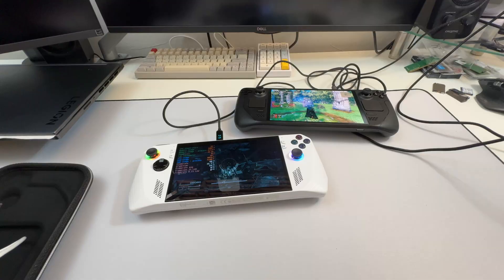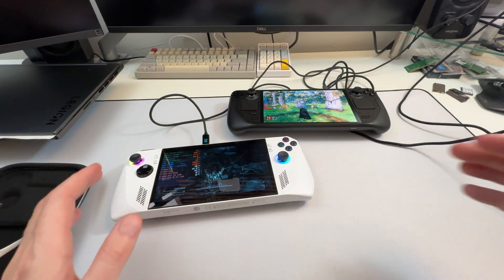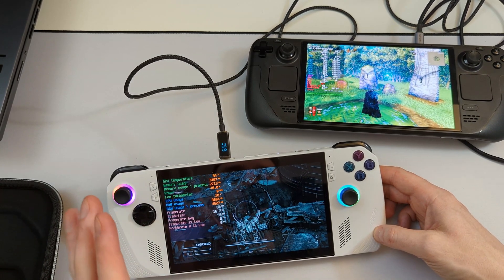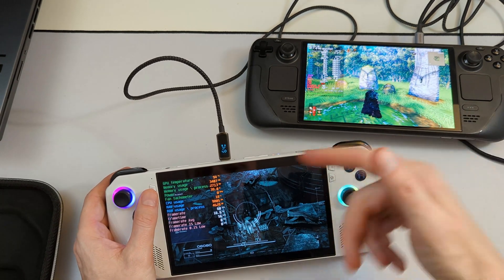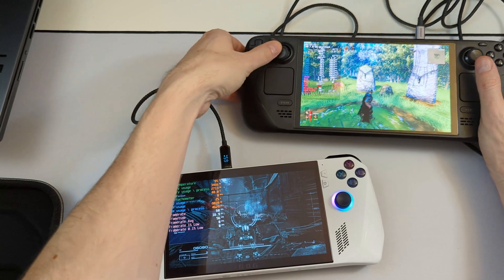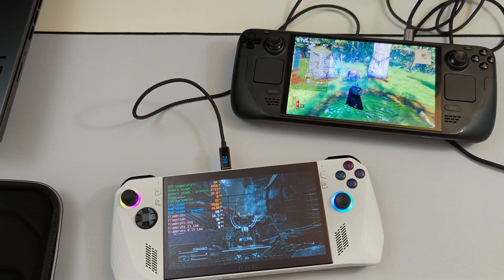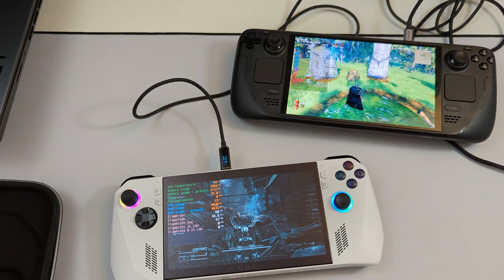Here's the serious test. I have two handhelds hooked up: my Steam Deck, which will pull about 45 watts max, and my ROG Ally, which can pull more — you can see it's going up to 65. I also have a Lenovo Legion Go, but I'm using the ROG Ally because it will boost aggressively and pull more power, around 40-45 watts to the CPU. The Lenovo Legion Go will just sit at 30, whereas the Ally boosts more. It's allowing me to go into turbo mode and supply 65 watts on the ROG Ally playing Armored Core, while also playing on the Steam Deck. That's a super compelling use case — you and your friend or partner playing on two different handhelds at the same time, whether a Steam Deck, ROG Ally, or Lenovo Legion Go. Nintendo Switch will be trivial — doesn't use nearly as much power — but you could easily run both at the same time.